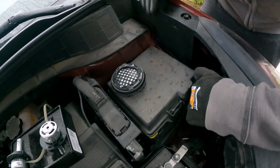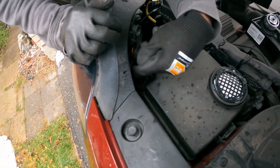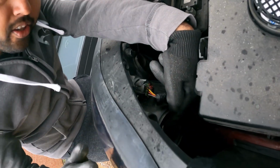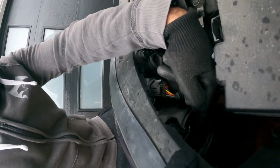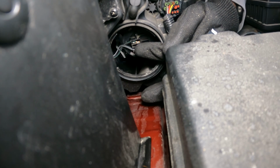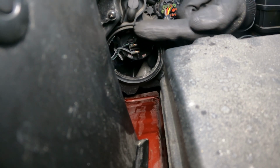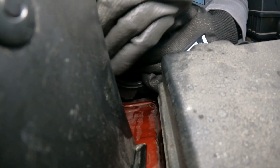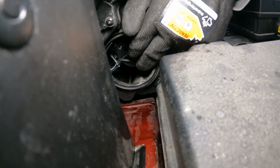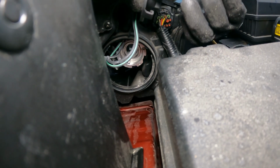And there's a bulb inside here. As you can see, there's a bulb right there. If you can see on the camera, let me put it on the proper angle. Okay, this angle looks good. So as you can see, this is the halogen bulb. We're going to rotate this one also anti-clockwise, so it's going to turn that way. As you can see, it turned a little bit and then it stopped, and now it can come outside. And we can pull the halogen bulb straight out of the bracket.